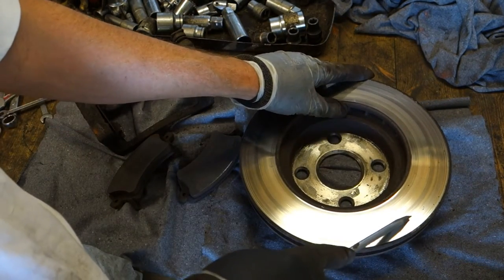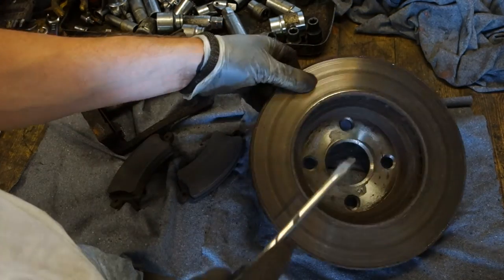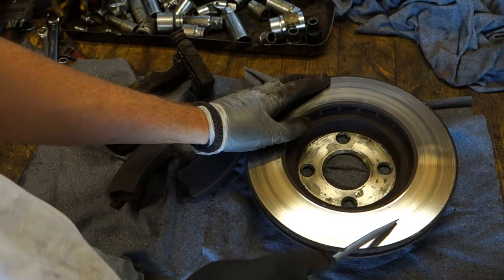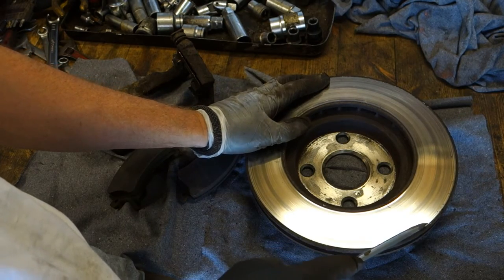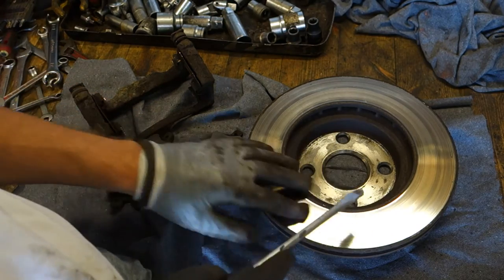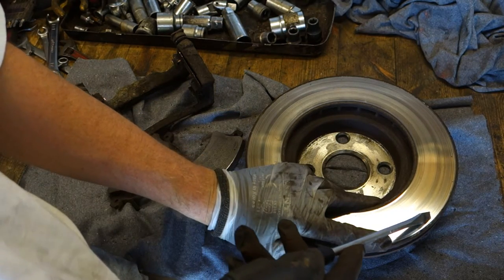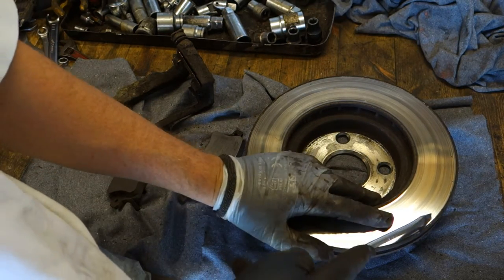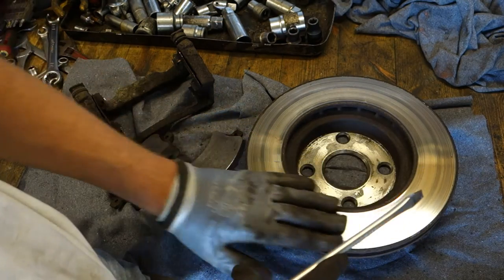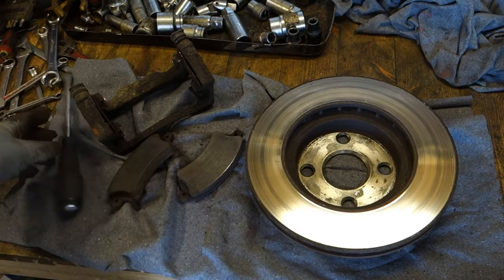And then when we look at that metallic plate, it must be plain, and if there are any holes in here, these holes generate this noise, and I can see that there are some small lines in here, and that means that I need to sand these things away.